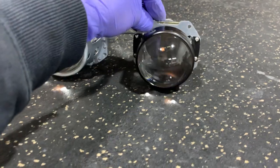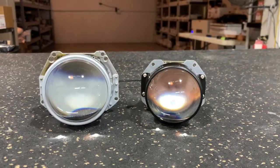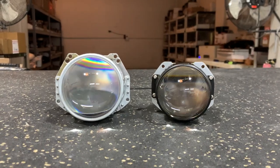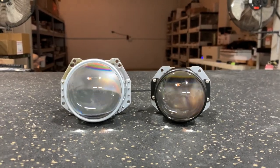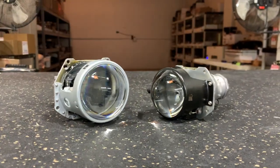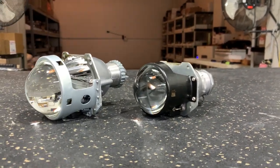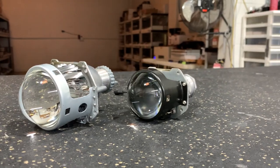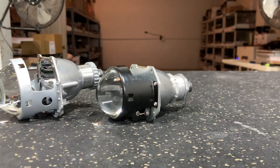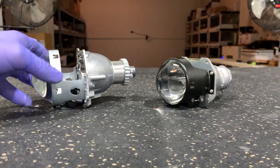The right is a 2.5-inch lens and the left is a 3-inch lens. You can use what's called a centric ring on the projector on the right, along with other 2.5-inch projectors. You can use a full-size shroud, and to the person that's not fully in tune with things, it's going to look like the same unit once the shroud is on. When fitment is an issue — such as a high beam projector conversion or a really tight low beam reflector where you want to use a smaller shroud — that's when you would use the Micro.